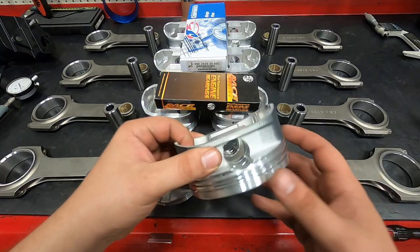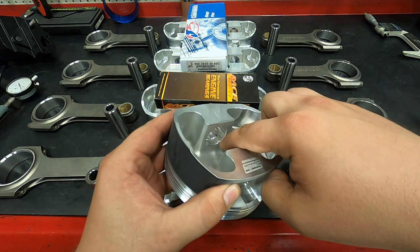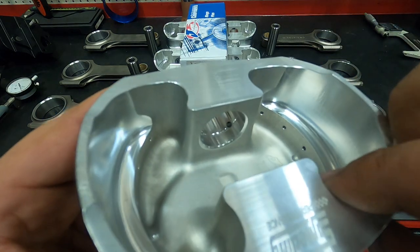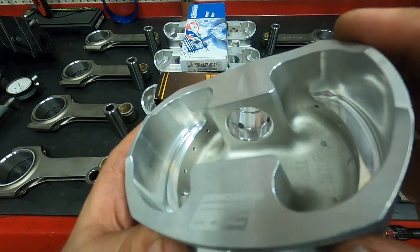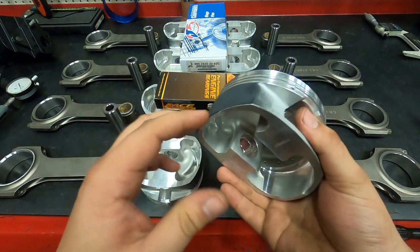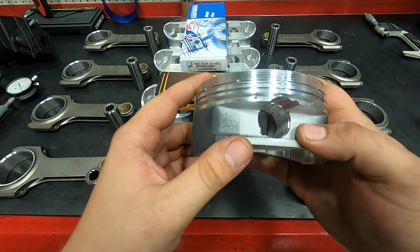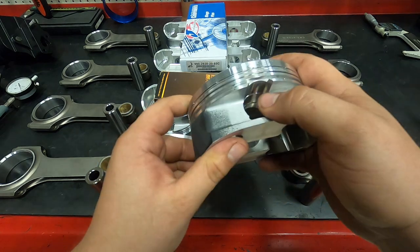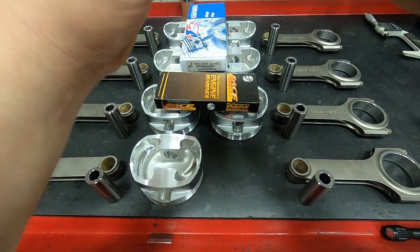Another thing that these pistons have that we hadn't mentioned previously was, if you can see here, these little holes. Let's see if you can see that. There you go. Those little holes there, that is a forced pin oiler. A lot of aftermarket nice pistons have that. Some don't, some do. It's a nice benefit. So what that does is, whenever this piston is coming down,